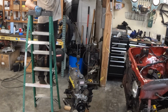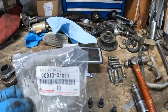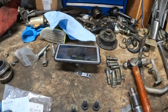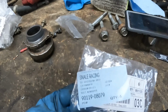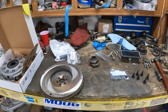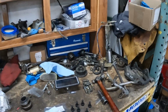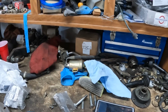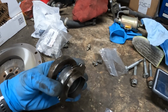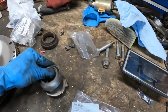Getting closer. So yeah, we are getting clear. Since this was the auto swap flywheel bolts, there's your flywheel bolt number, the 22Rs and 11mm, it's cleared. Pressure plate bolts. Those are probably in your bolts pile, but I figured what the heck. Flywheel, clutch. And while we're here, I ended up running into this throwout bearing issue where this is clamped onto this lower piece. So the hub ends up not being exchangeable with the new throwout bearing.